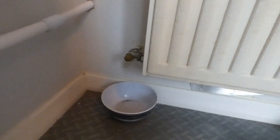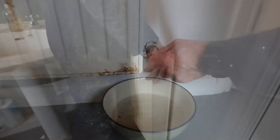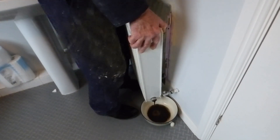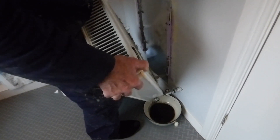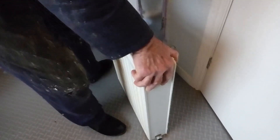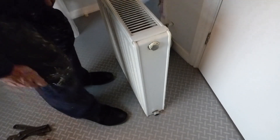Make sure there's a bit of movement to get the rad lifted away — this is the bit where you lift it and pull it off. There'll be a little bit of black sludge in there, there always is. Tilt it one end and get it all out. Be careful of the floor — if you're worried, just stick some tissue in the ends when taking it out.